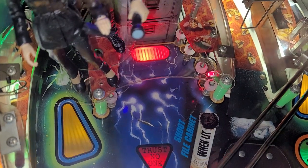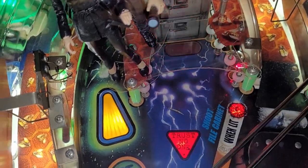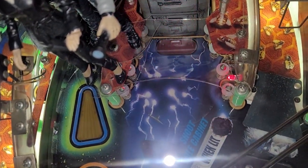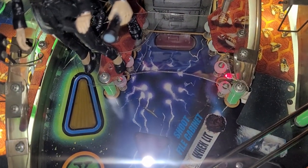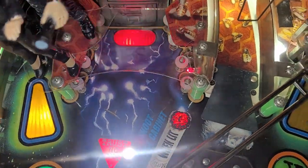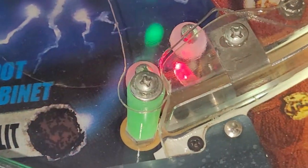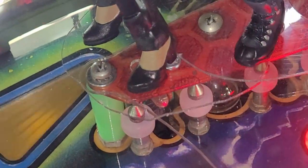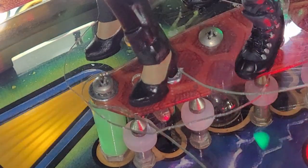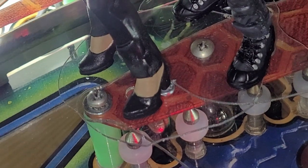Here I can show you what I'm talking about. See the red light right there? That is the transmitter, which you can obviously see illuminated with your naked eye. With Williams, you have to hold up your camera and look at the opto through the camera in order to see whether it's lit or not — and that's how you can tell which one is transmitter and receiver too. On the other side, that little LED there with a bit of light on it — that's Scully's foot — and that's how you can tell it's aligned well, because the red light is right at the tip of the opto.